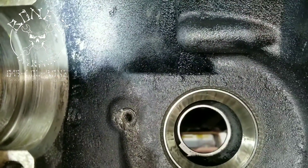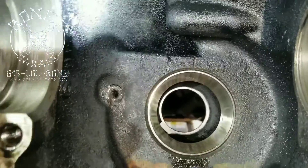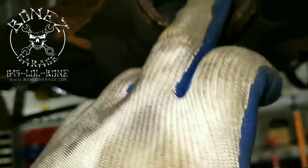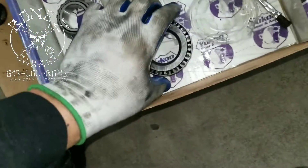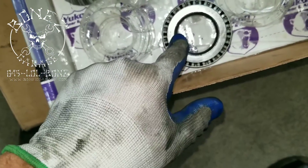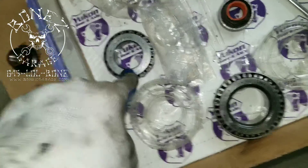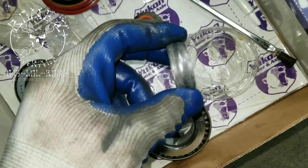Hopefully we don't run into too many issues — I couldn't guarantee it, I told them so. We put new races in here and another new race right there, those are brand new. These are the brand new bearings, exactly the same as my test bearings — same Timken model numbers. This is your front pinion bearing and this is your rear pinion bearing.